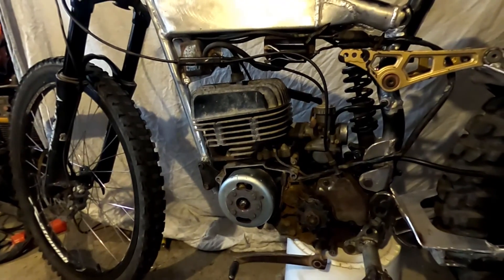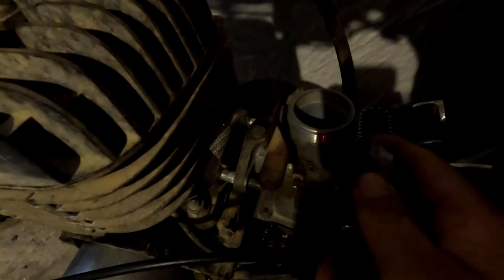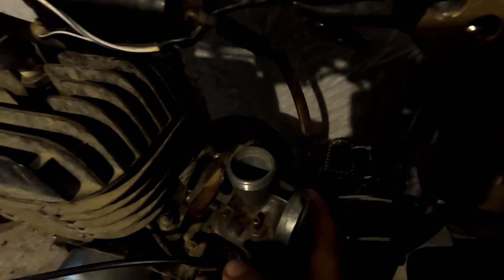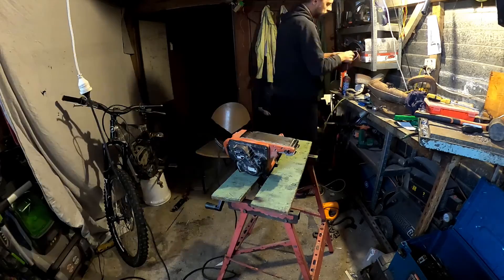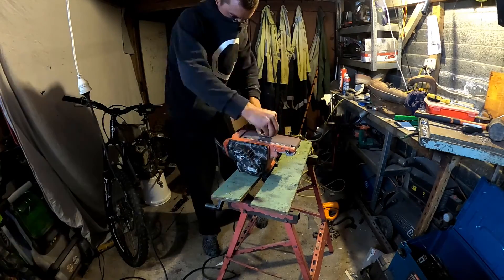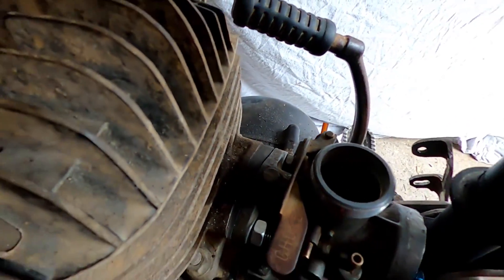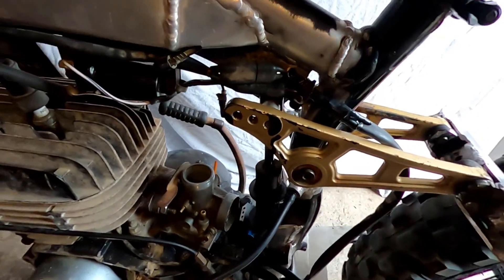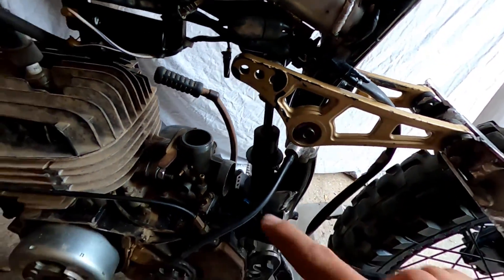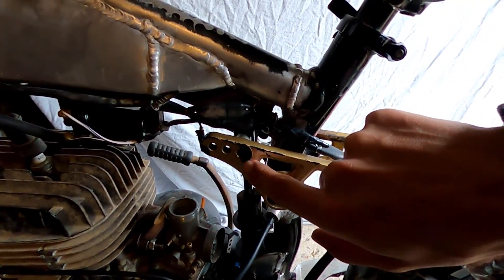I've slotted these holes a bit so I can tip the carburetor sideways enough. Now I've got to file this down - I've got that sliver in there now, carburetor's offset a bit which is good. I played with this for ages last night and ended up taking this spring off here because it was still hitting. If I have the pivot in this position it works.